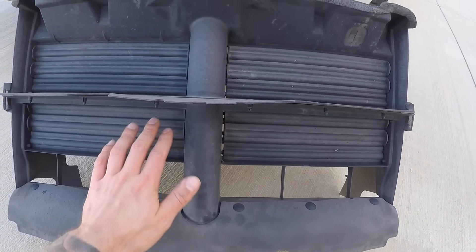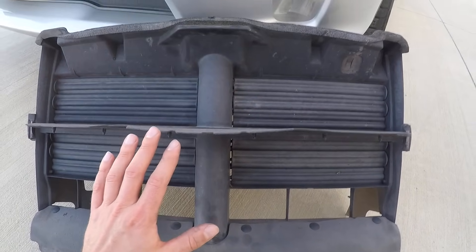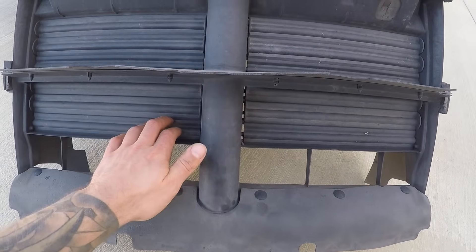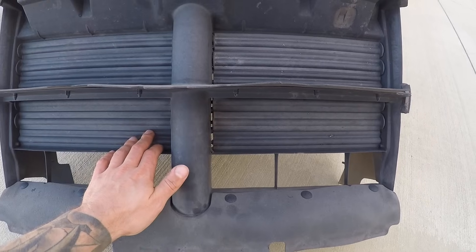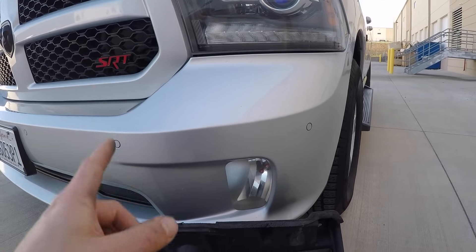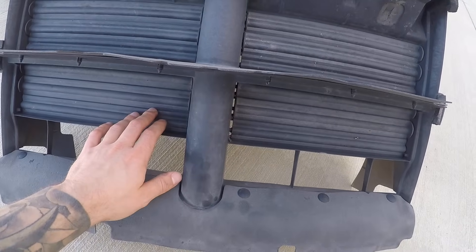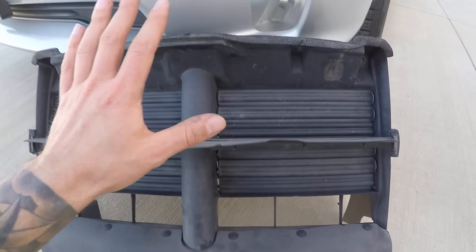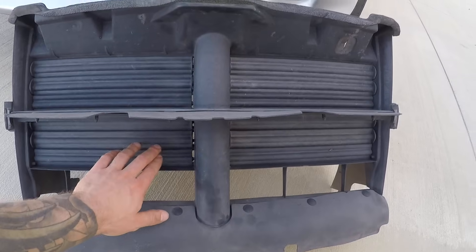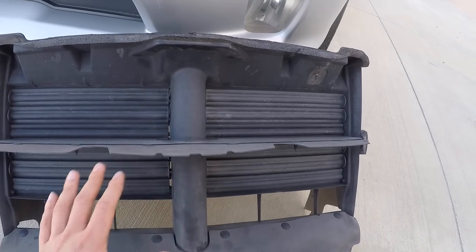With the AGS installed, they're going to try to stay closed to get you to the 200-degree mark. In another video I mentioned, I put a 180-degree thermostat in my truck for performance reasons, and these were trying to stay closed to get the truck up to 200 degrees even though the thermostat was already opening and circulating coolant through the engine and radiator — this was impeding airflow. That's one of the reasons I removed it. In winter or cold climates, they'll try to stay closed to bring your temperature up sooner.